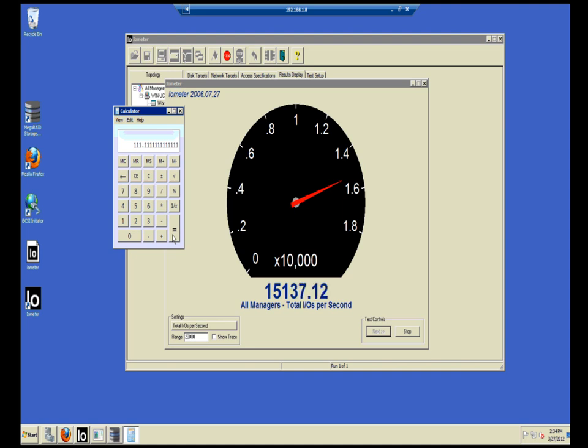That gives us 111 IOPS per drive. Yeah, their IOPS are very low, again, because typically when you use these kinds of drives, they're not even thinking about IOPS. Correct. It'll go 100 megabytes a second, and that's fine. And if we times that by 14, and this is without the cascade, we're going to get about 1,500 IOPS if we did the regular RAID 0 with just the drives.